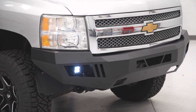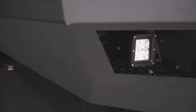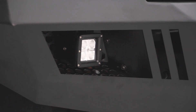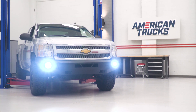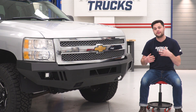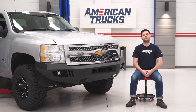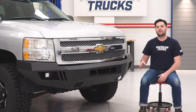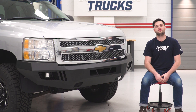The big draw with the Xtreme HD is gonna be those five-watt Cree LED light cubes, three inches across, definitely gonna add a nice bit of utility. They're completely plug-and-play, and the light they throw — 6,000K color temperature — that's gonna be a bright white leaning very slightly toward the blue side. They're IP67 waterproof, which means they'll take a meter of water for 30 minutes. Aluminum housing, polycarbonate lens — really high-quality stuff, exactly what you'd expect.